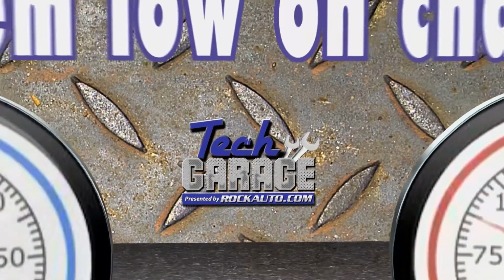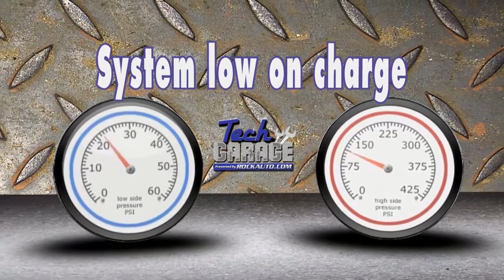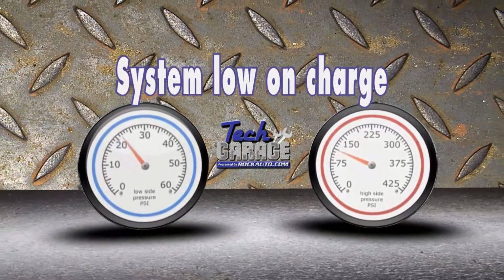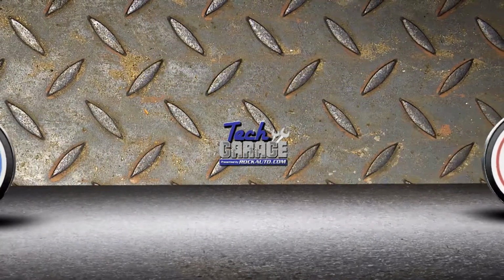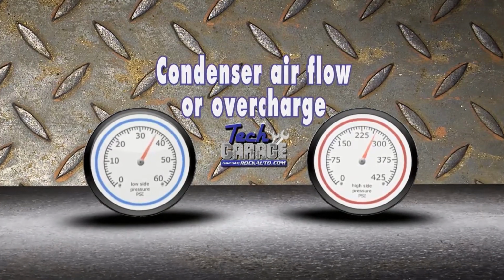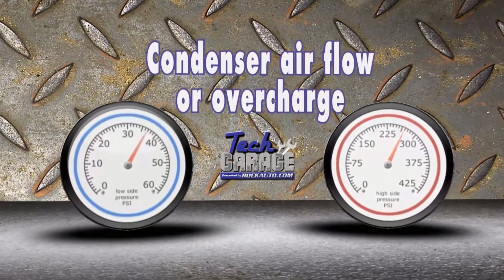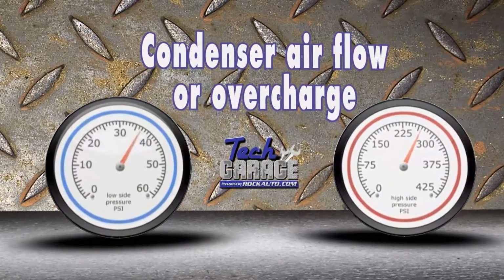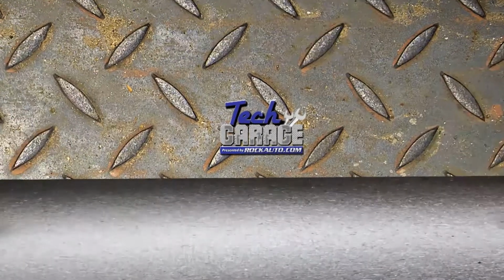Now this one, Brian, this system's low on charge. It's pretty obvious: low and low. The compressor can't push, and it can't pull to create that balance we talked about. Now, condenser airflow or overcharge, too much refrigerant in the system, starts to get hot in the front. Once it gets hot, they're both going to climb up a little bit. So the low side's high and the high side's high. Usually that's a restriction of airflow in the condenser.